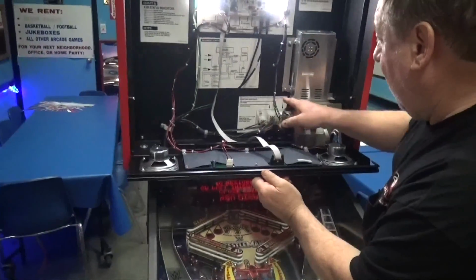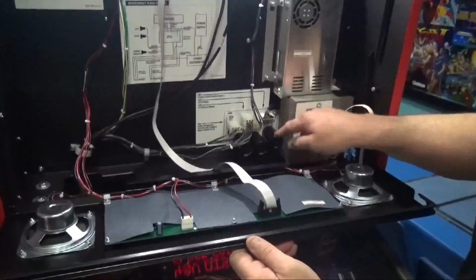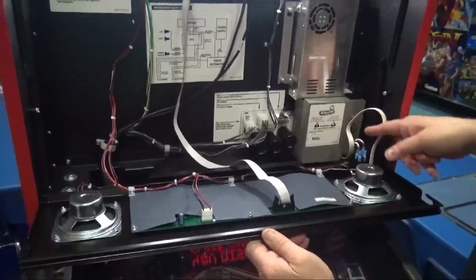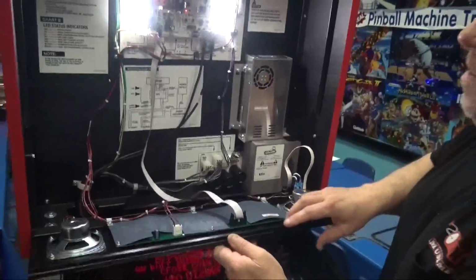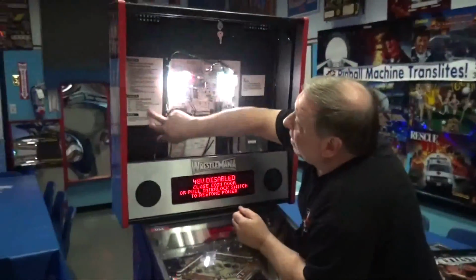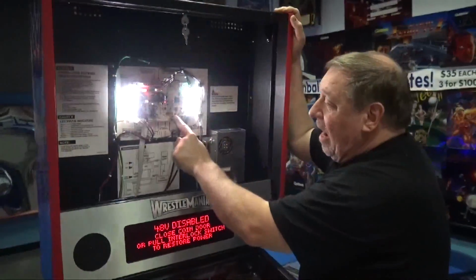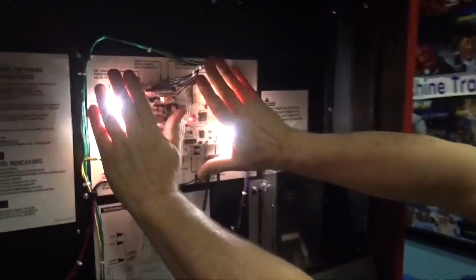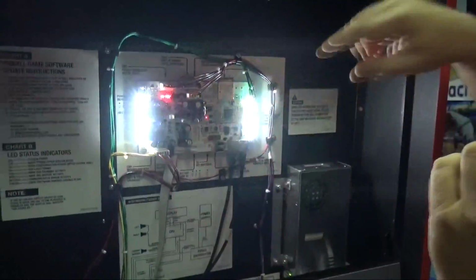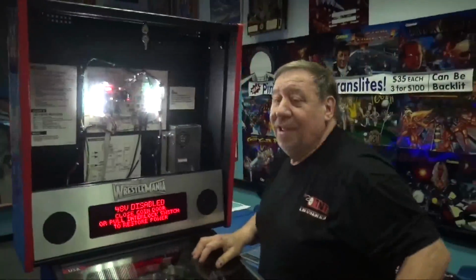This is called the CPU power plugs in there, playfield power, so everything filters through there. So this whole corner now is out of the base, and it's in the head. Also, Stern has provided a nice bit of software instructions stuck in there, and then right here, that's your stick memory for updates, game updates. See right there, it says game updates there. And then your dip switch pack. Isn't this nice? This sticker they put in there so you can't screw anything up.